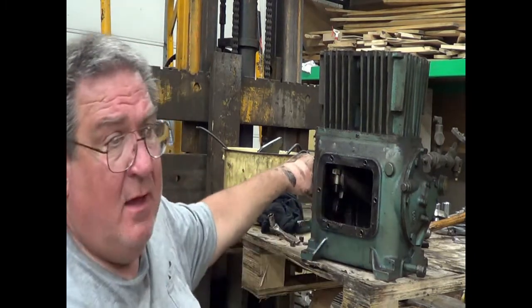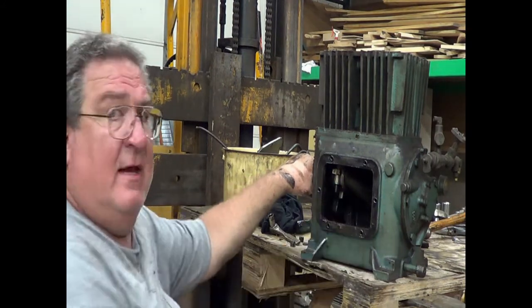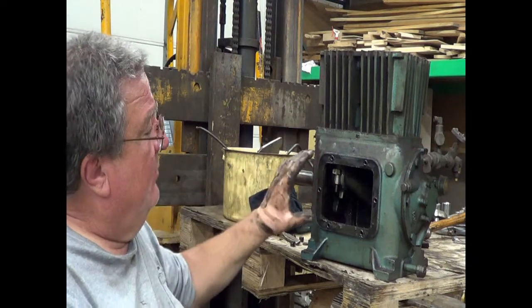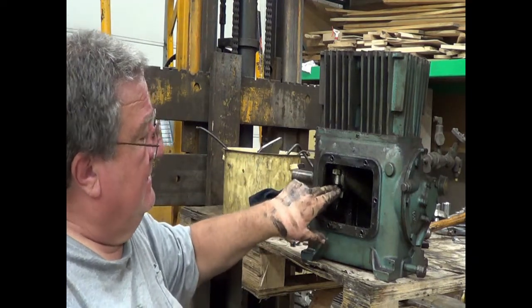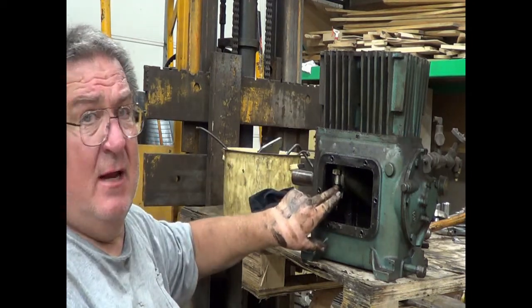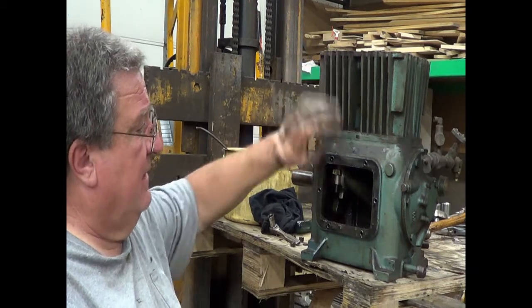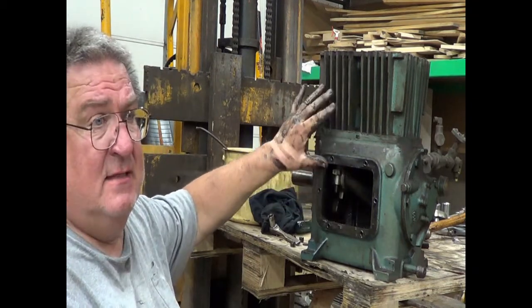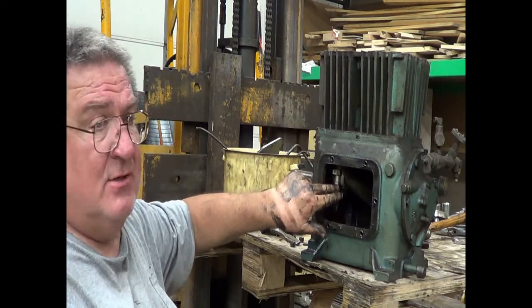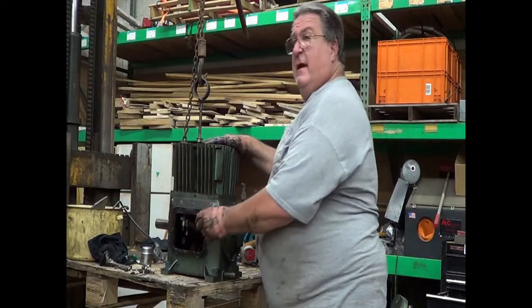They're not going to come off. You might be wondering why I went to the trouble of taking the side cover and those nuts off just to pull this up anyway. The reason is these are held in place and not flopping around, and these nuts are easier to get off while the cylinder is still on. Even if we pull the cylinder and let the pistons and rods flop, it's still easier to get the nuts off while everything is in place up here.